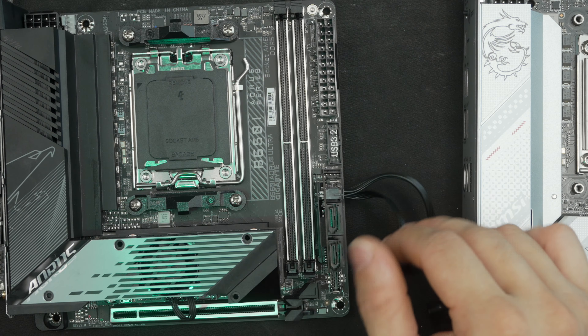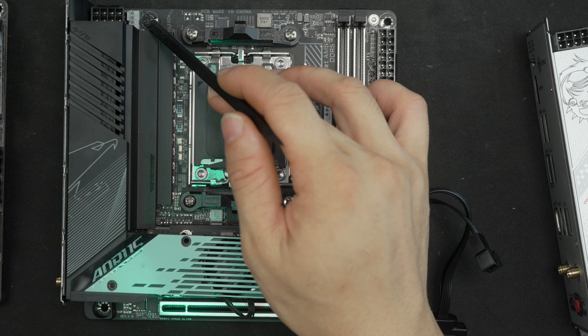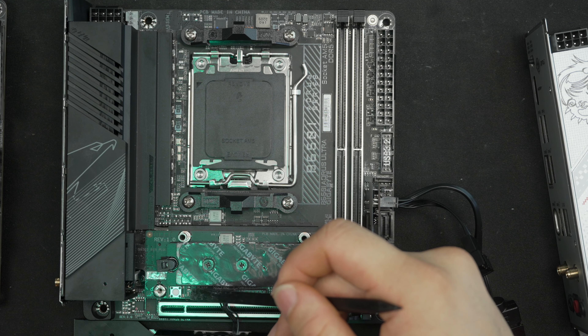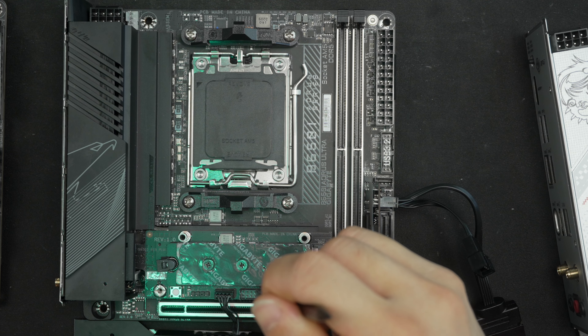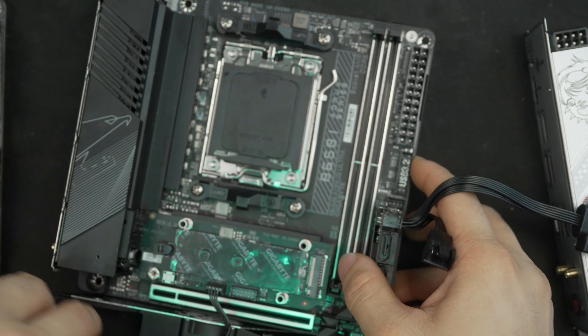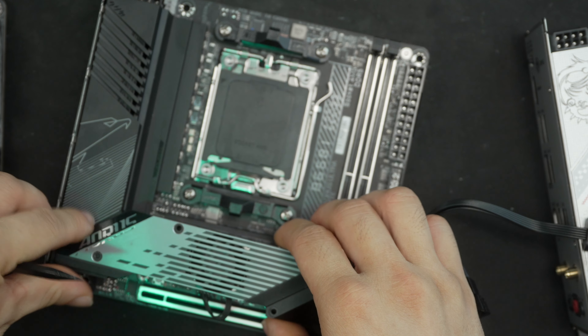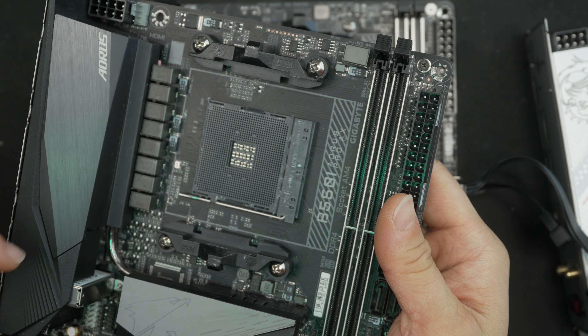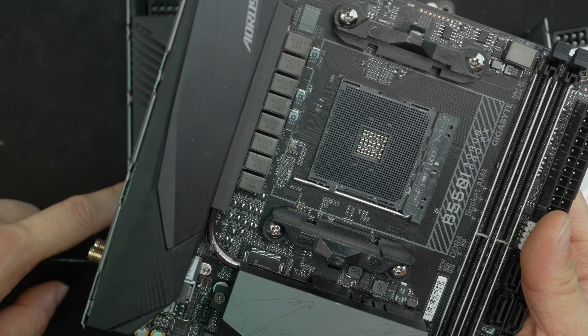The SATA ports are on this add-on card — that's fine — and there's 12-volt RGB if you use that. But the layout overall is a mess. The CPU fan header is at the top, no problem, but the second mini fan header is next to the add-on card and needs a dongle; the third is on the riser card and also needs a dongle. The three-pin ARGB header requires you to get under this heatsink. If you need a USB 2.0 header, it's right here under the heatsink as well. And front panel audio? It's tucked away in a corner underneath the rear IO heatsink. The B550i has some randomness too, but at least most things are accessible and not hidden. This board's layout is much worse.